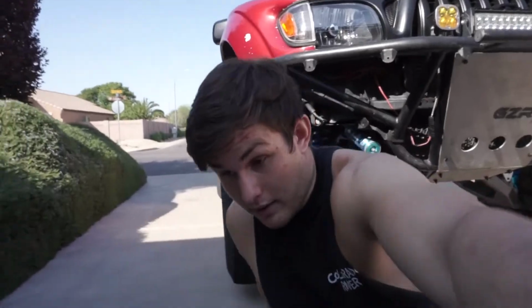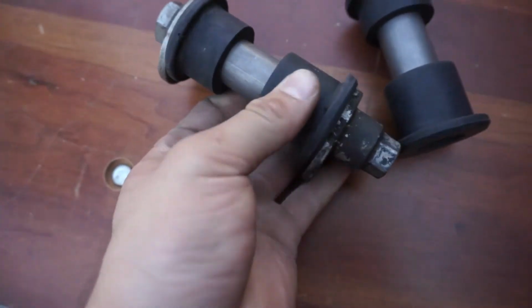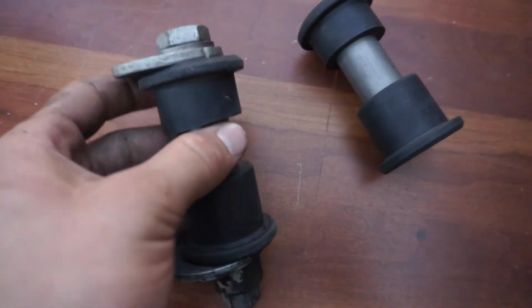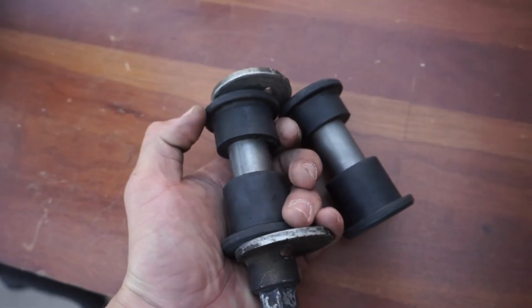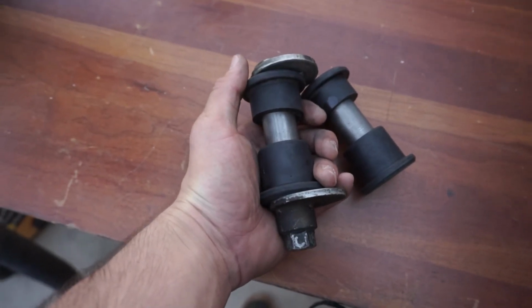That's the guys who made my long travel kit, and he said that he would send me new bushings and also a sleeve made out of a DOM tube that fits around the misalignment cam. I'm guessing it'll help disperse shock better or something like that. I ain't no engineer or anything like that, but I'll show you guys how that works. I already got one side out, and the misalignment cam goes through this tube right here. And these are gonna be pressed back into the lower control arm. So I'm gonna be installing those. I'll show you guys how that goes next video.